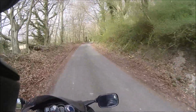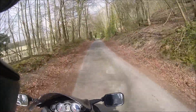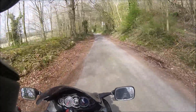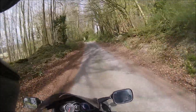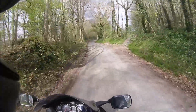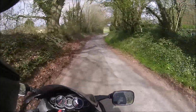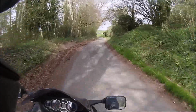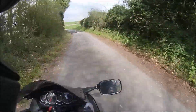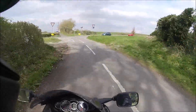Replaced all the pistons and all the seals. And this was the test run. And it's a success. The other problem I had with the Wemoto kit, not so much the kit, it came with the bleed nipples, so I put on brand new bleed nipples, and I think when I was trying to bleed it, I was just getting the air back through the threads on the nipples,